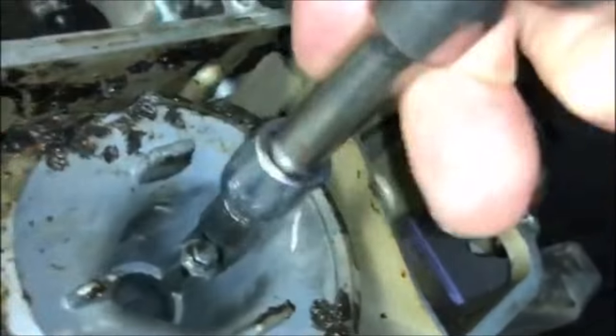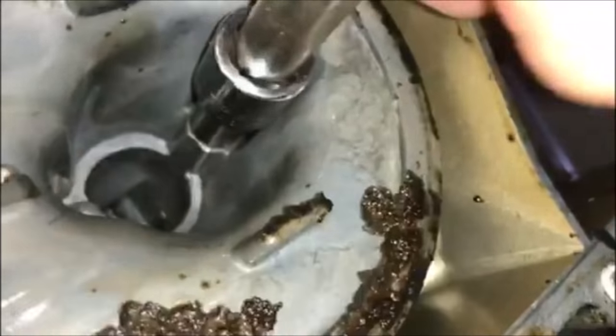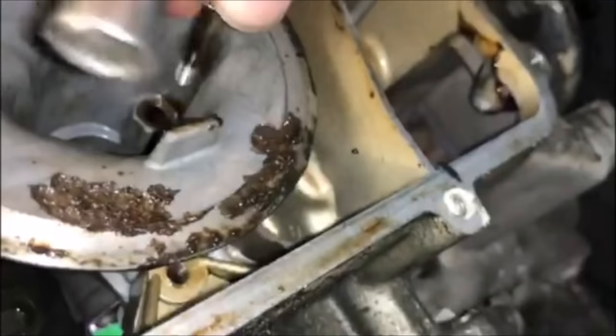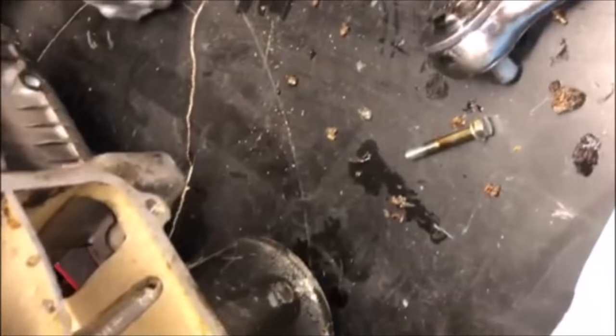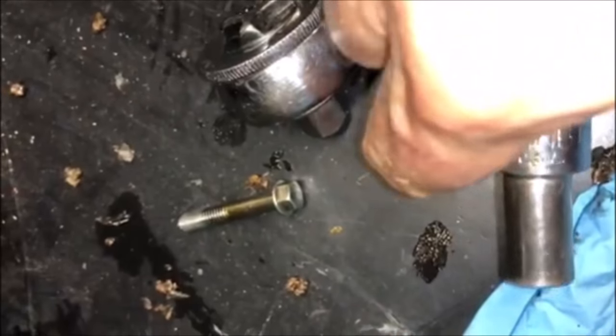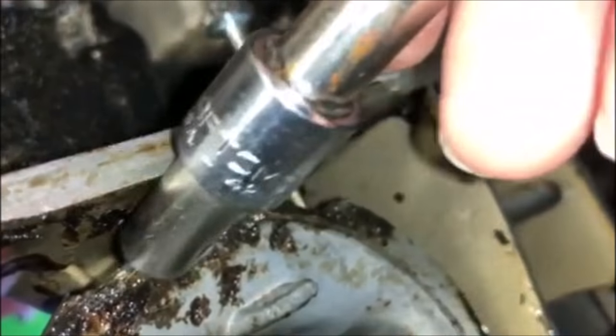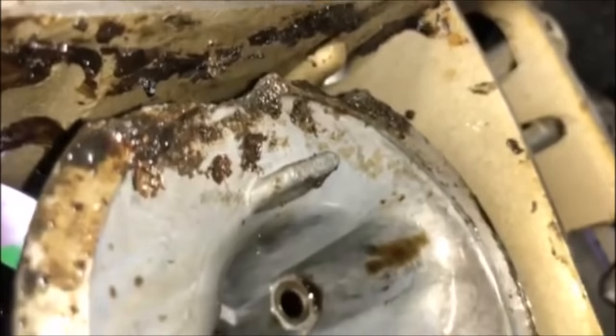On the bottom half, one important thing I hadn't done until now is remove the oil pump — that's very important. You take it out and make sure everything is good, because you don't want to put the whole engine back together and find out the oil pump is bad. In this case the oil pump was really a mess — not only that, but there was all kinds of grime, sludge, and actual broken pieces inside. Here's the screen I took out — you can see what I mean.